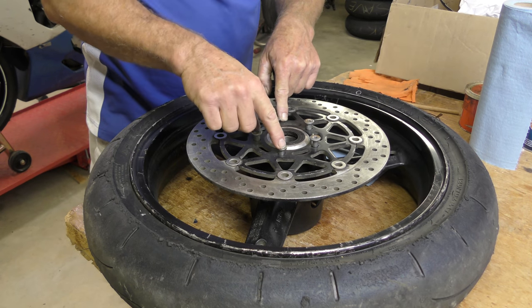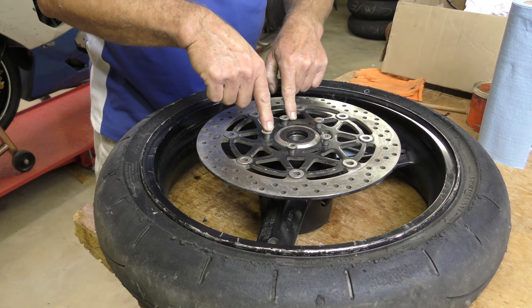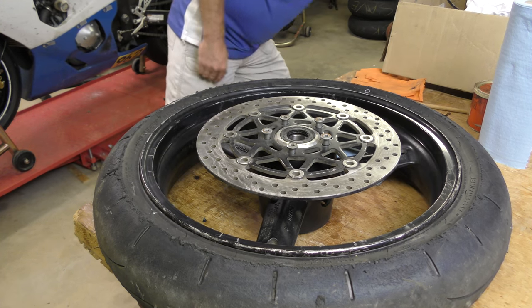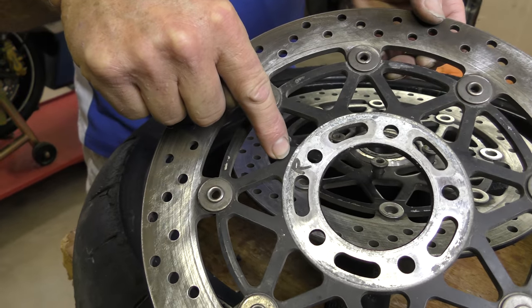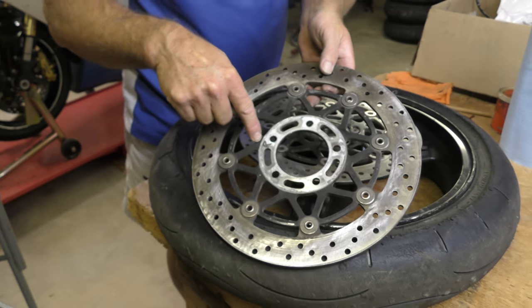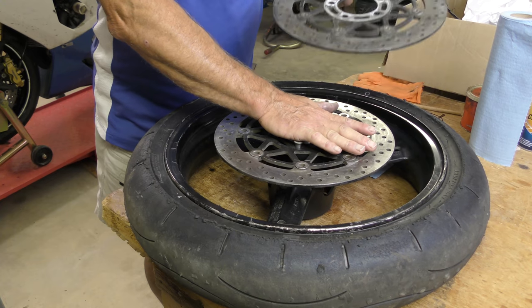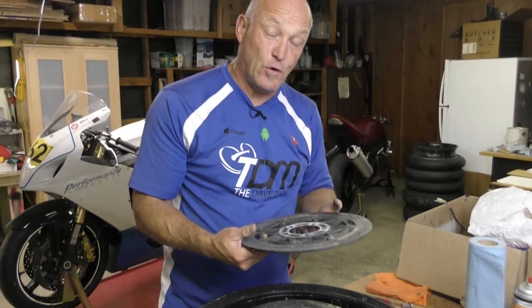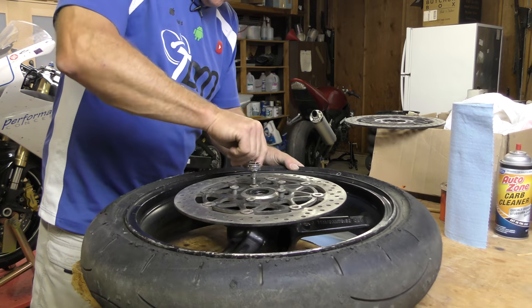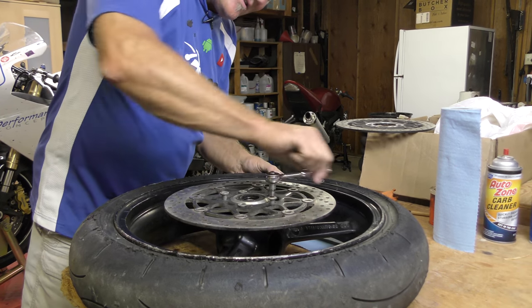We'll go ahead and torque the brake bolts to the correct setting, flip the wheel over, put the rotor marked R, because we did this when we took them off, so we know they go back in the right place. Put that to the other side, hand tighten all of these up, torque them when we're done, which will be when we pull them out and put the blue Loctite in. At this point, because we're rebuilding the bike, everything's a dry assembly. The tires have got to come off because these are roller tires. So at that time, I can torque it all up. Right now, it's about putting the bike back together.